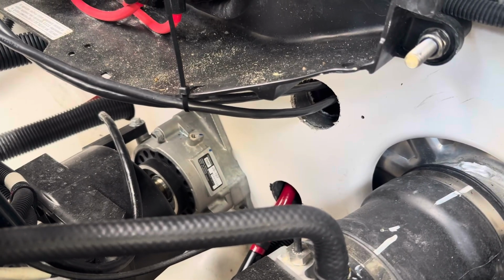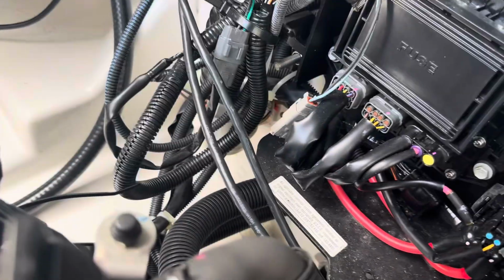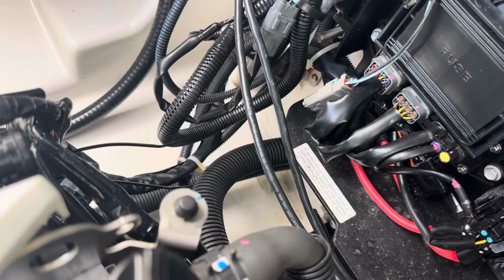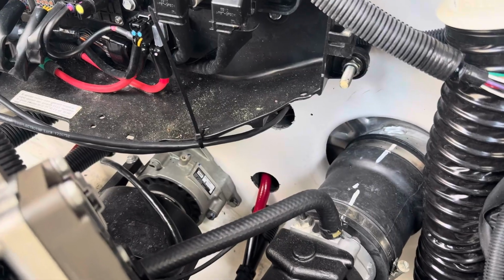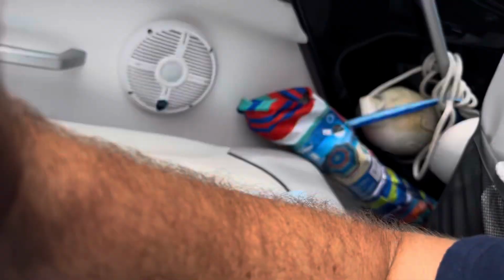using this method here with a syringe, where you pull the hose off. You can see the hose there. And I injected 30 cc's of grease in. The hose also comes with no grease in it. You stick your grease gun on the Zerk fitting there, it has the rubber cap on it, and you fill your hose up with grease because there's no grease in the hose. And then you install it back on so it looks back like this. And then you do a couple more pumps of grease with your grease gun here. And then you have a filled intermediate shaft bearing.